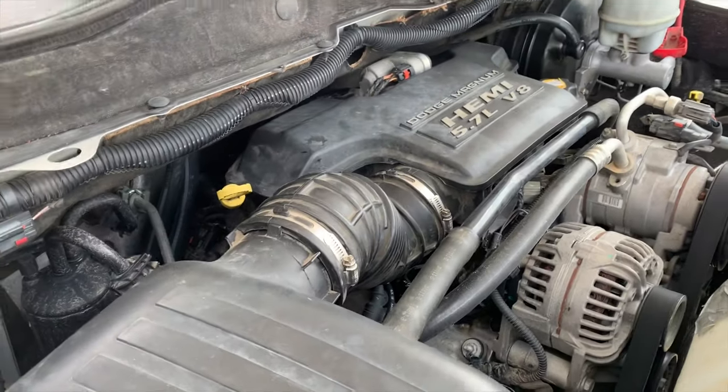The real goal is more power. I want to get this truck breathing better — that's how I start all my builds. Put some long tubes on, maybe a good shorty set of headers, keep the Borla muffler in the back and the tips, get an intake and a tune. For the future I'm thinking about working with Texas Speed and Performance, using one of their cams and their tuning to really wake this thing up. Knowing my Hemis — this is my second one — they absolutely hate heat, so I'm probably going to add some more coolers like I did on my Challenger. I'm just trying to keep this engine simple, reliable, and just a little more powerful.